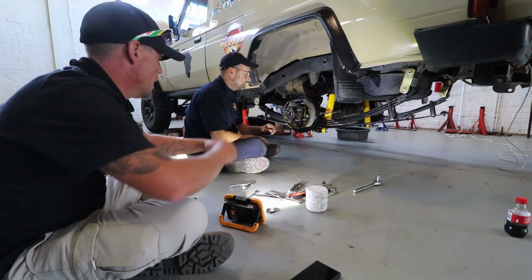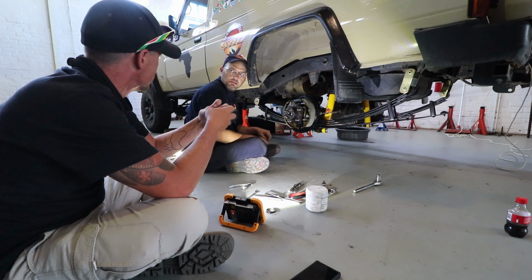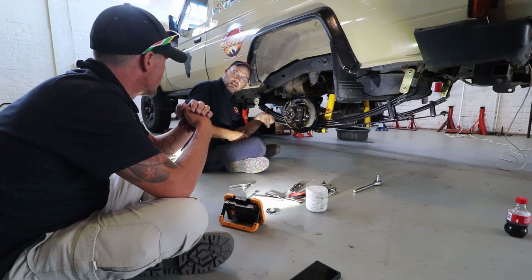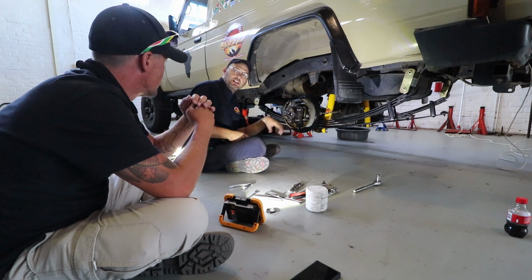And that's pitted from the other seal as well, just with muck getting in there, it causes that pitting. The seal's got a spring at the back that actually pushes onto that side shaft, and that's where that pressure point is, that's where it starts wearing it out. Plastic is wearing out metal.